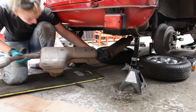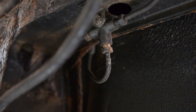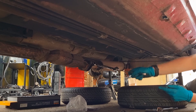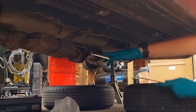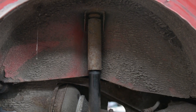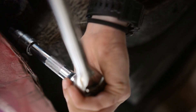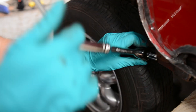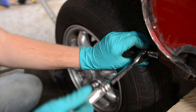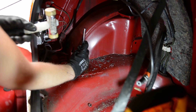In order to do this I removed the exhaust, the handbrake cable and disconnected the brake and fuel lines. A little tip to get more leverage on stubborn bolts is to use a second spanner. Next I disconnected the upper mount points and placed a jack under each end of the subframe, then loosened the bolt holding it in place. With some butane heat, back and forth persuasion and more WD40, most of the bolts came loose except for one, so I drilled off the hex head and then used a punch to remove it.